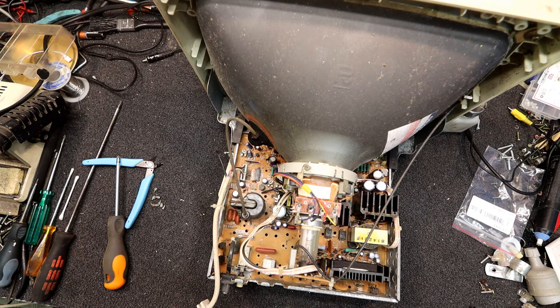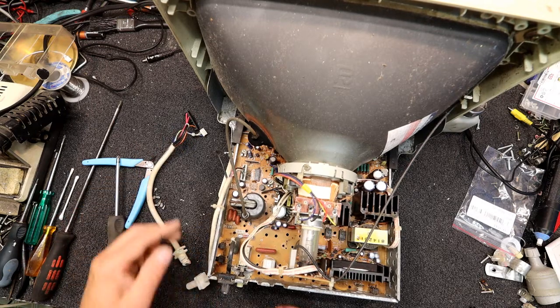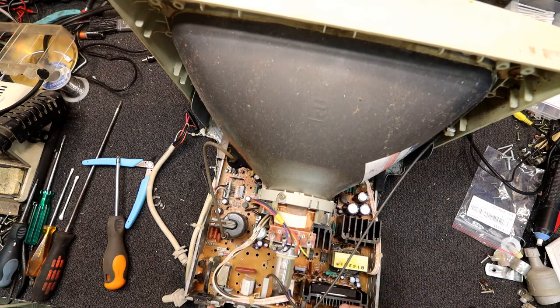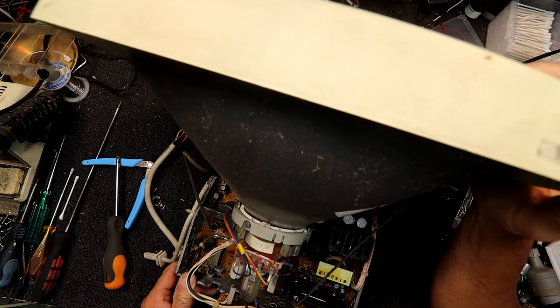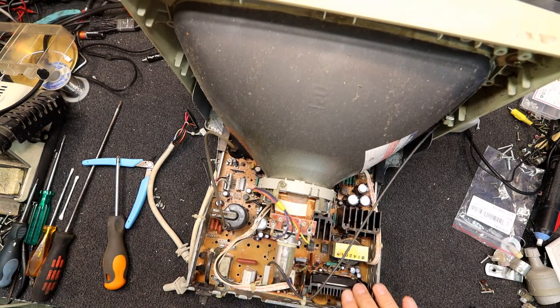There's also a little four-pin connector. There are really two big black wires and two big red ones, the orange and a few other bits and pieces. We've got a switch mode power supply here — the main chip that runs the thing is an STK7358 on the 240 volt side. 240 comes in through a power switch, filter cap, bridge rectifier, into that chip, then a main chopper transformer.